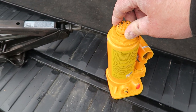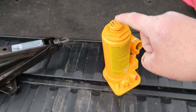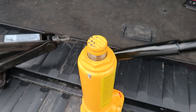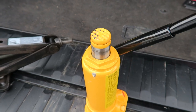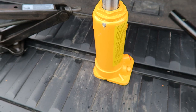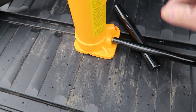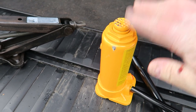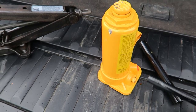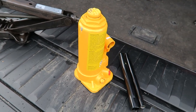The other option is a bottle jack — this is a hydraulic bottle jack which can lift 4 tons of weight. You simply pump away and the piston comes out the top. Just keep pumping and it will lift all day long. When you're finished and want to lower it, you use the valve here — open the valve and press down with your thumb. That's it. This is the one we're going to use today, so let's get under the van, put it in place, and lift the caravan.